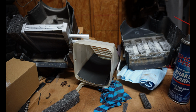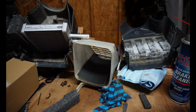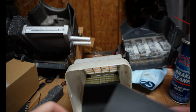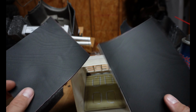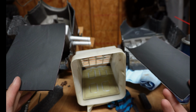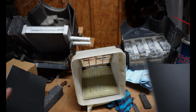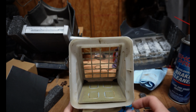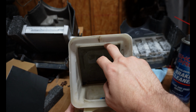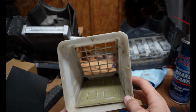Alright, so I've got my last pieces for the top spacing here cut, and I've got some glue setting. So right now we're going to work on the flapper for the fresh air door, the recirculate door. So you're going to need to cut out 2 pieces of foam just like this. I'll put a link in the description on where to get the stuff that has the right thickness and whatnot. And what happens is this little flapper is supposed to have that foam on it from the factory. Well, it wears away, so air just bleeds past this.